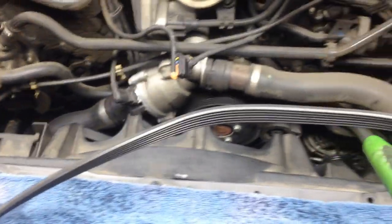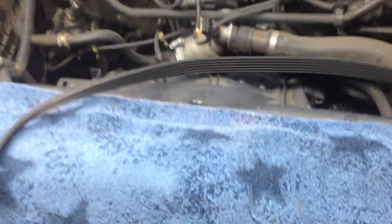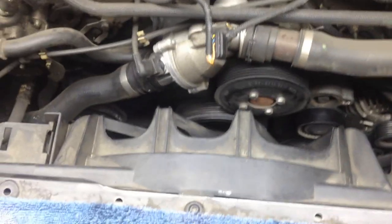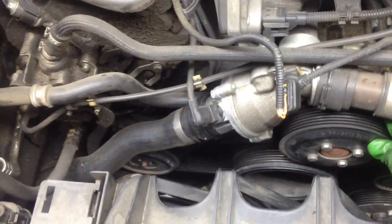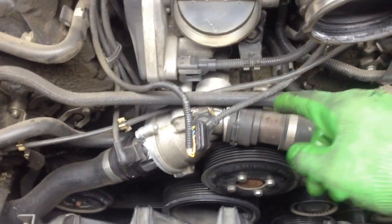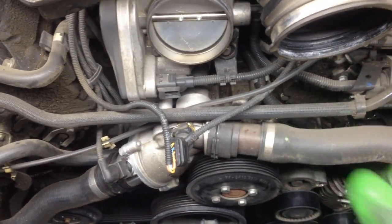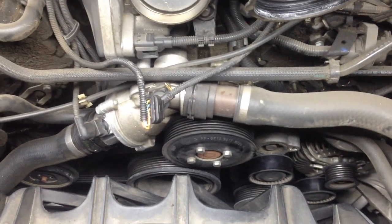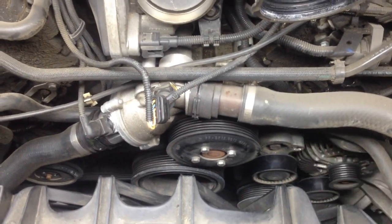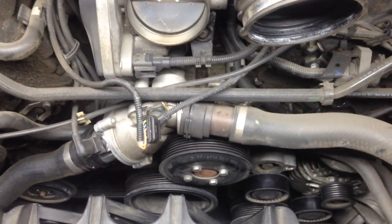My belt looks pretty good — there's no fraying, the grooves look nice and strong, doesn't look warped at all. The belt looks okay and my water pump pulley looks good. I've got about 134,000 miles on the car, it's a 2006. The water pump bearing pulley looks good, no cracks, no spraying around the water pump, which means the water pump doesn't have any cracks. But when a water pump goes bad, that can come on you suddenly and you can be sitting on the side of the road. Always check for bearing wobble; if coolant sprays out, that leads to overheating and then you're in trouble.